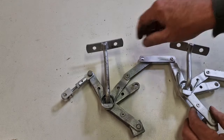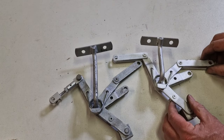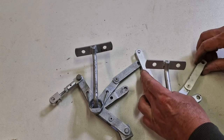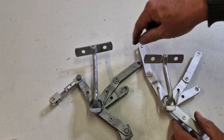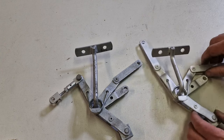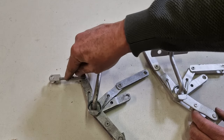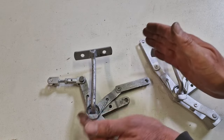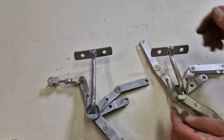And that also, of course, when you mount this on an early car with early brakes, you can imagine this coming further out, your handbrake is already in pulled position if you have that pulled out. The other thing you recognize here is a synchronization adjuster. With this one, you can adjust the synchronization of the pads towards the rotors.